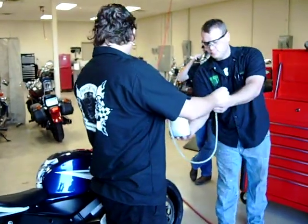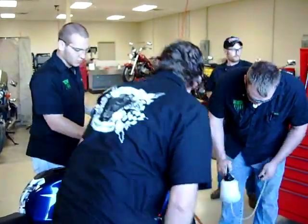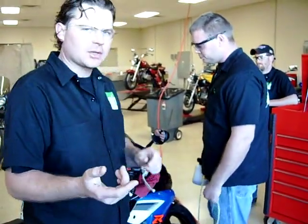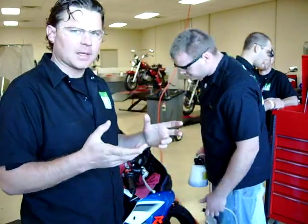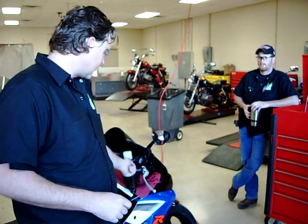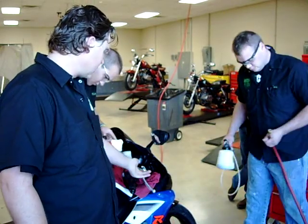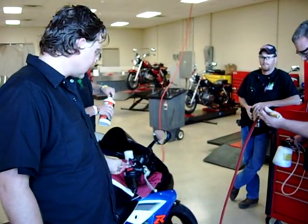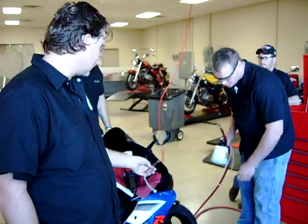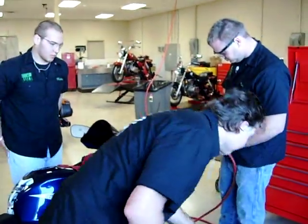First off, we're going to make sure our reservoir is full. Zach, we've got an 8-millimeter wrench here — just get prepped and ready. I really recommend watching our other videos on this topic because we don't repeat every single procedure in each video. One thing I will say: we make a point of using the closed end of the wrench on your brake bleeders so you have real control to open and close it. If the wrench slips off and it's suddenly wide open, you're going to end up putting air back into the system.